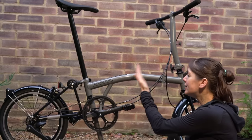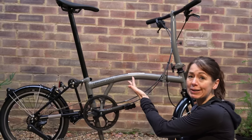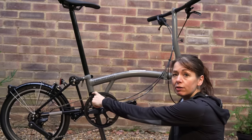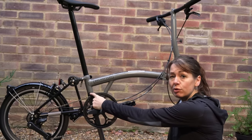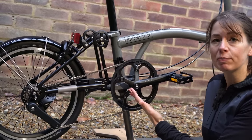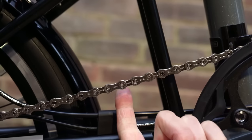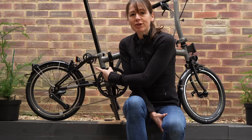The mainframe is the same as used on a standard Brompton, apart from being painted a P-Line colour. It does also have a chain catcher stuck on the down tube — really commonly found on mountain bikes and Tour de France bikes. The crankset is the same as used on a standard Brompton; however, the chain is different. It has hollow pins to save weight. It's a YBN chain, 10-speed, and assuming we counted correctly, has 102 links.